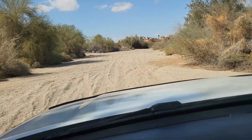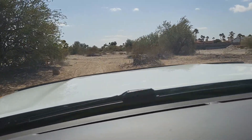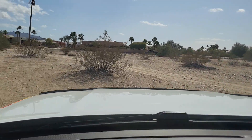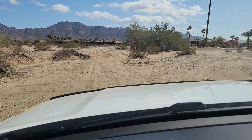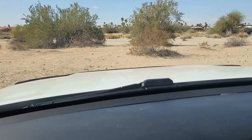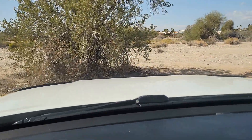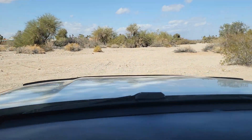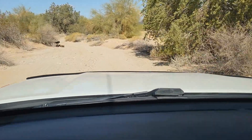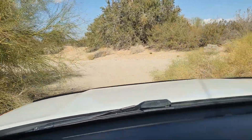We've got the Goodyear Wrangler all-terrains - ultra-terrains. Let's pop up here so we can get her in two-wheel drive. All sorts of fun off-roading spots to test tires and your new suspension. I did some trimming of my fenders. The Goodyear ultra-terrains run a true 33 inches in the 285/70-17 size - they're a little bigger. Put them on 9-inch rims with a negative 12 offset and you get rubbing pretty bad on the 4Runner with just a 3-inch lift. But yeah, I'm bombing around in two-wheel drive in some fairly deep stuff and negotiating some fun trails.